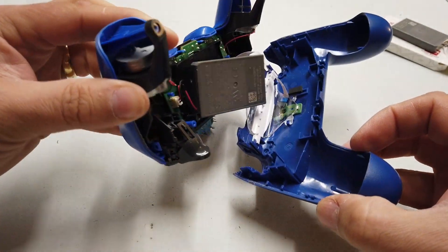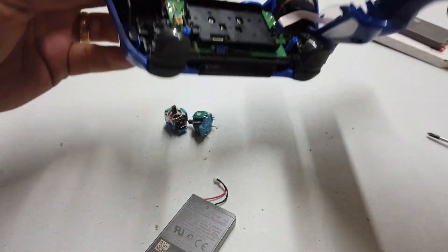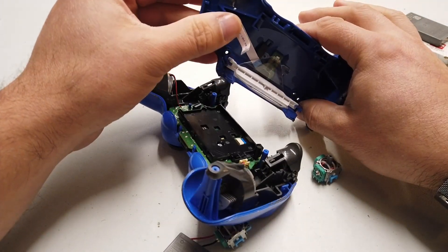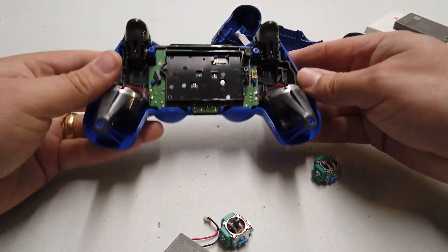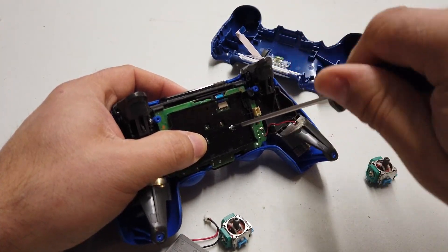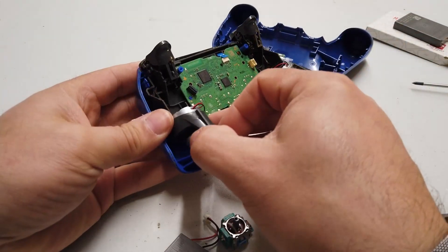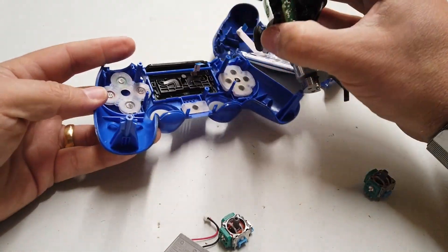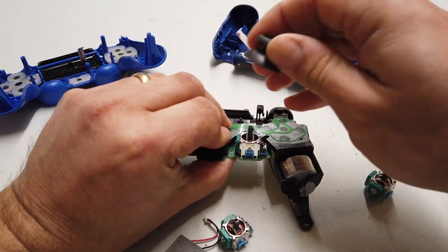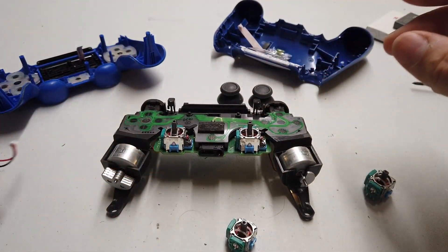Let's take this second controller apart. First, let's remove the battery so we don't accidentally switch on the PlayStation downstairs. Then remove the ribbon cable — you just pull it carefully directly upwards. There's a screw here to undo, and coming with that screw is the battery tray. Then you can pull the plastic out and the whole assembly comes out in one piece. Then we can remove the little rubber grippy sticks — they just pull straight off.